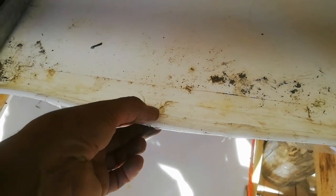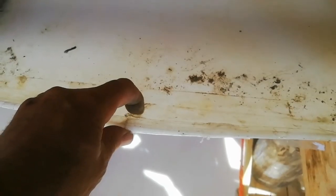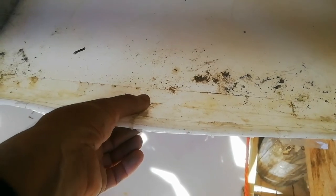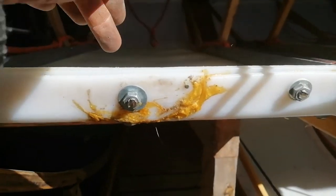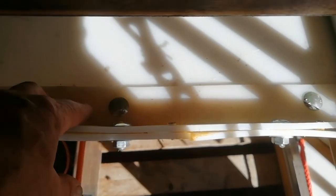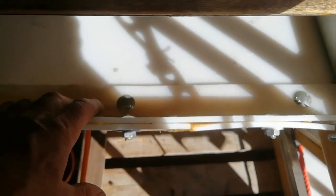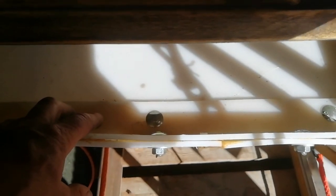This one at the back has a crack and it's just got clear Gorilla tape on it. It's held for the season but I think I'm going to take the tape off, see what's underneath, and maybe add a bit of plastic to the back. This next one is quite a messy but effective repair: one piece of plastic added vertically, bolted on — you could use rivets but bolts I think are better — and then another piece of plastic here. The trick is to catch them before the crack spreads, and certainly at least get a hole drilled at the end of the crack.